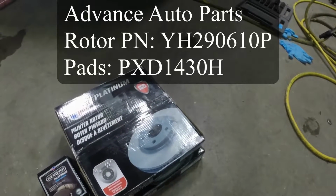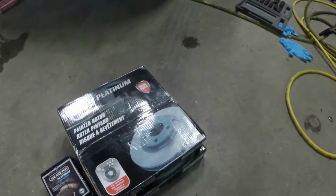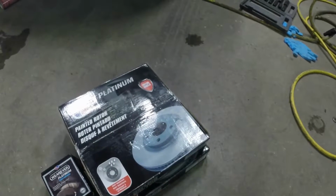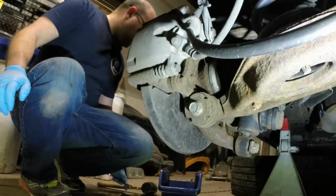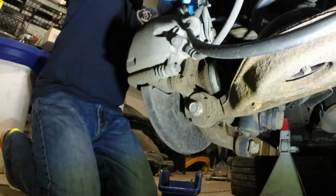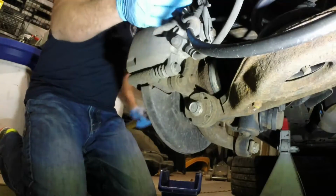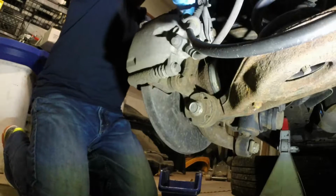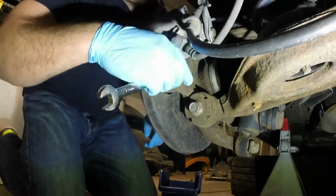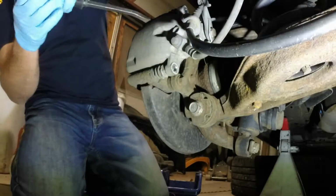Hopefully they do. I'm going to grab a 13 millimeter wrench for the caliper, a 15 mil for the hold down for the caliper, and we're going to go from there. All right, and just so everyone knows, I am going to take the part number for those rotors I grabbed and put it in the description below, so that way everyone can see it. Right now I'm just taking off the caliper hold down bolts, pulling off the caliper.